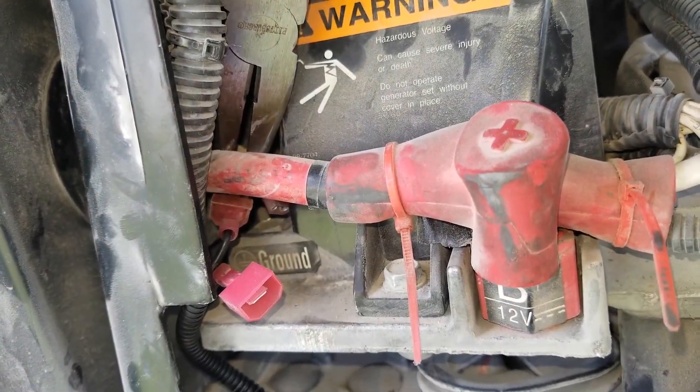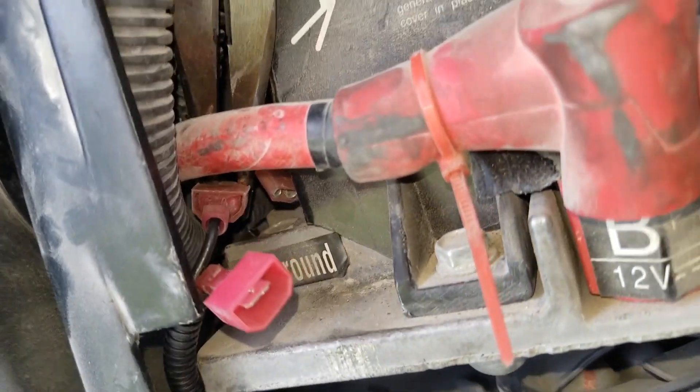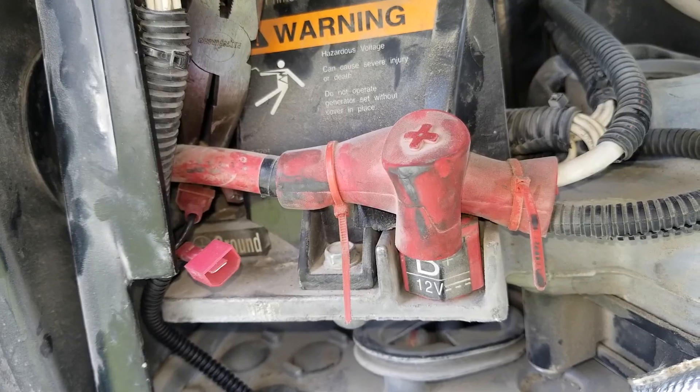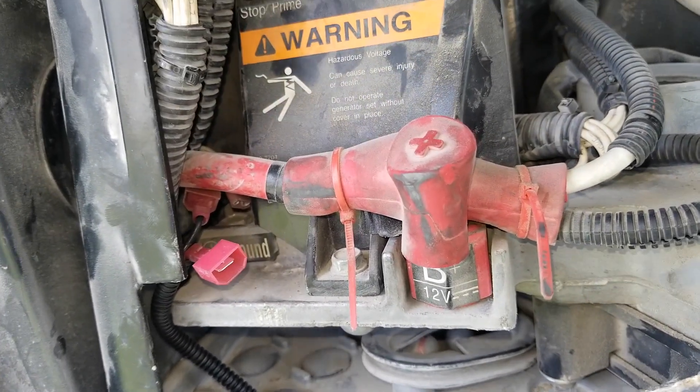Reconnecting these wires — they always give you an extra one to two millimeters to work with. I put a needle nose back there to hold the wire as I push it in. Make sure you disconnect the battery when you're dealing with electricity and gasoline — at least that's what they tell me.